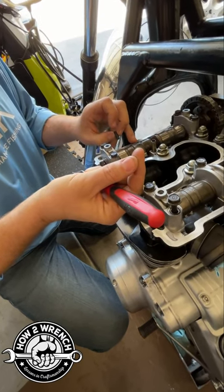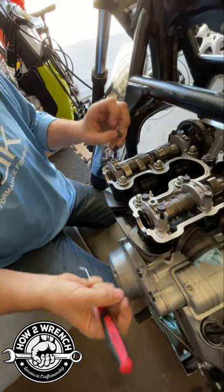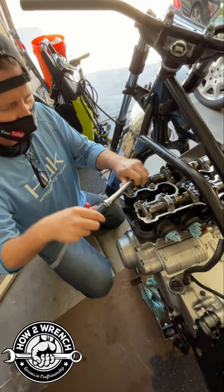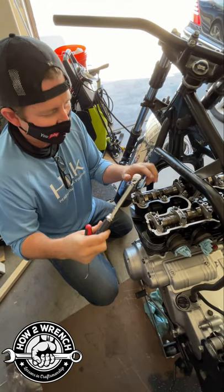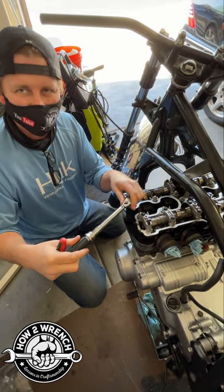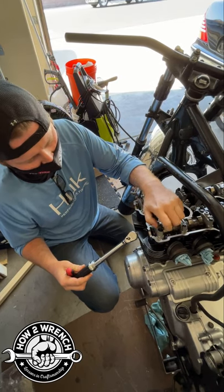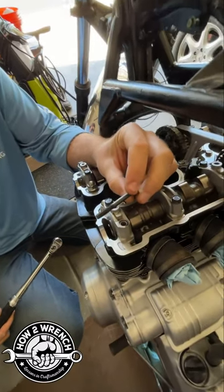So we do want to take a tap and clean the threads out in here, and make sure there's no debris or anything else. I went ahead and took his torque wrench to see if it has the capability to do 96 inch-pounds — it felt good. I didn't feel like anything was bad, and then I got to this bolt and I was like, something's not right. I had the 'oh shit' look in my eyes for sure. So I quit — and wait till you see this: it's necked and just ready to break.